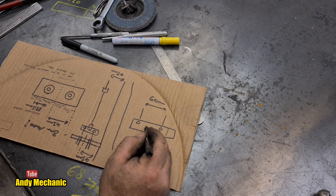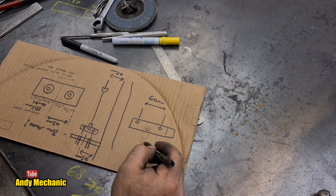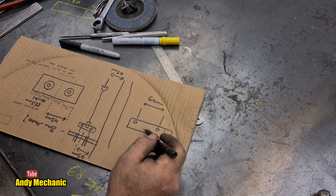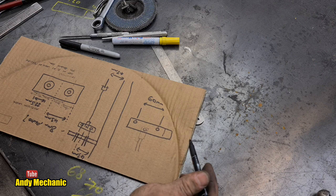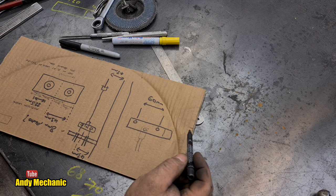And then from there, there'll be a clevis mount, which will be here, like that, and then there'll be the stainless steel bar. You may say stainless steel, because it's all I've got. It won't be as bent as that one, it'll be nice and straight. And then we'll use a bolt, probably an M8 bolt through there. And it'll be a bolt that's not threaded all the way, so we've got a nice purchase and not too much free play, or too much movement. We don't want play on there. I want to get the whole thing adjusted up properly and it should work really well.